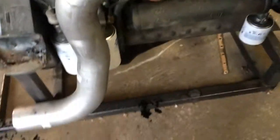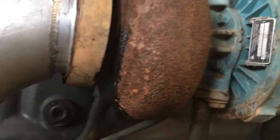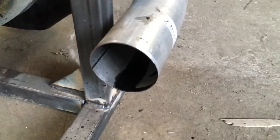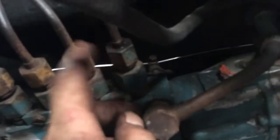Alright YouTube, there's your oil leaking out of the turbo. It's actually nice and warm — not hot, warm. No cooling on this, but the head's warm, not hot. There's the exhaust — lots of oil, fresh oil too. Over here you can kind of see what I've got going on. These fuel lines are horribly cracked, though none seem to be leaking. I did get a little bit of fuel out of that injector there.